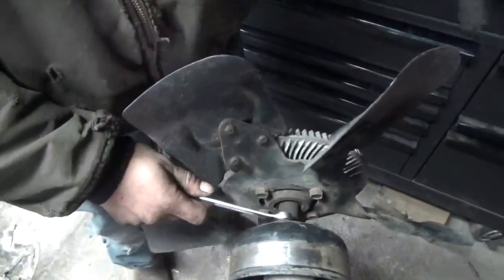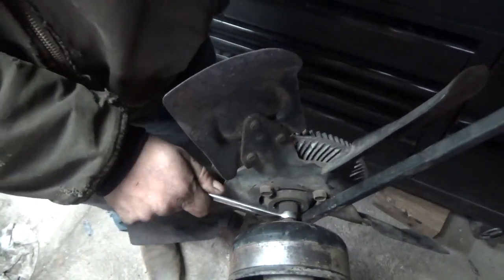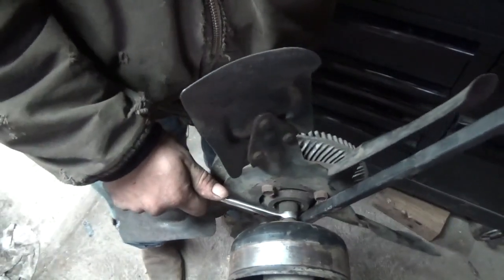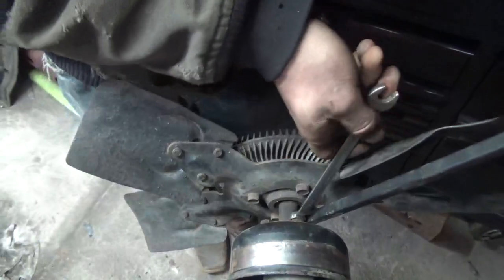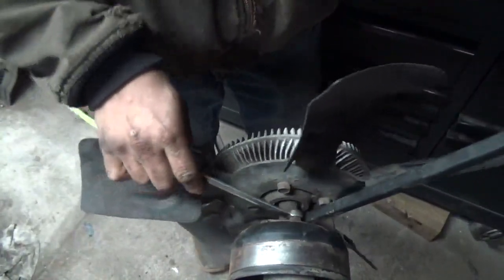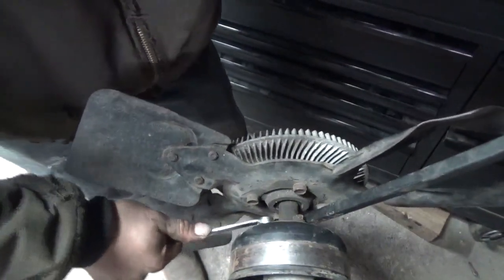So what do we do? Well, we get ourselves a pry bar. Wedge it between one of the bolts and the hub, or two of the bolts. And then you can loosen it. I was tightening it. You can loosen it while holding it in place. So you break your bolts loose that way. And after they're all broken loose, you should be able to still spin them out by hand. So again, there we are. Hopefully you can see more clearly.